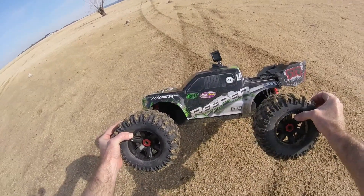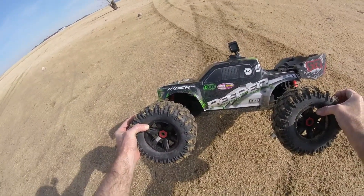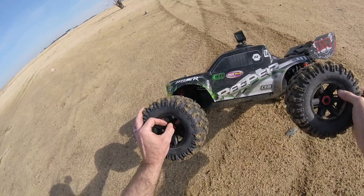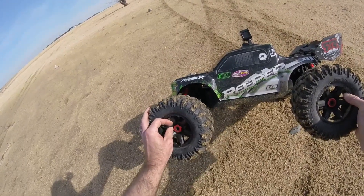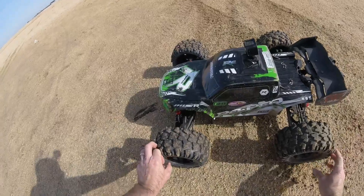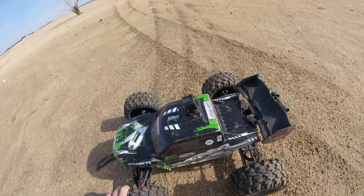They've got a perfect amount of ballooning. I did have to modify the hex because Traxxas has this kind of weird hex on the inside, so I had to cut out a bunch of the little tabs inside the hub and basically bore it out for 18-19 millimeter.